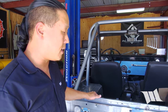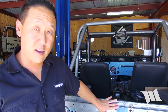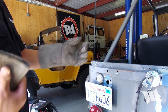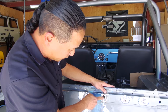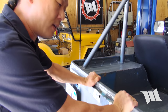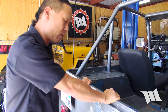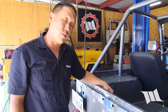Working on the back end of the CJ5, you could see that it had actually been either rear-ended or backed into something hard enough to do some damage to the tail. It doesn't have a tailgate — it's all one piece back here — and you can see it totally tore the support bracket. I came through and welded it up to give it a little more strength, then had to flatten it out with the sander so the bracket would fit. This whole thing used to buckle in and out just by moving it around by hand, but now it's pretty much solid. I'm going to come back through and reinforce it with additional bar stock.